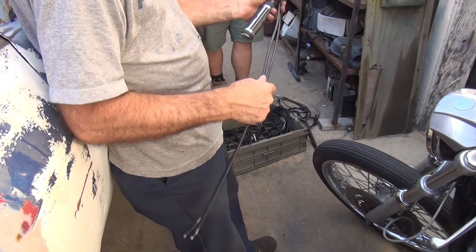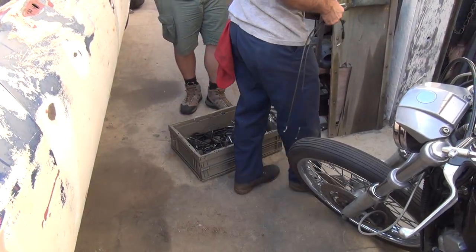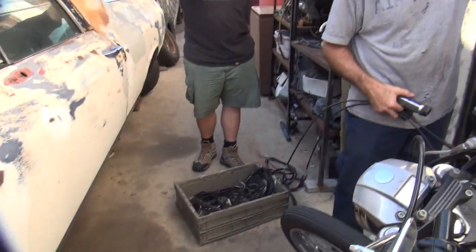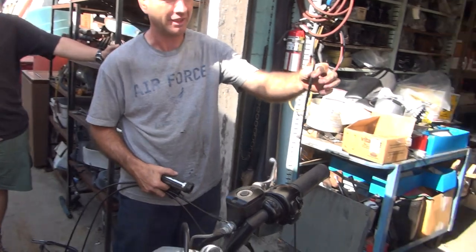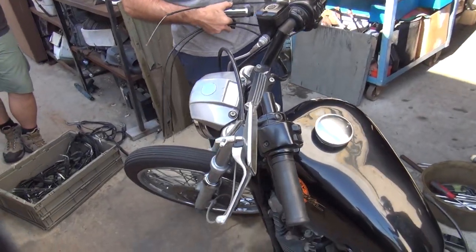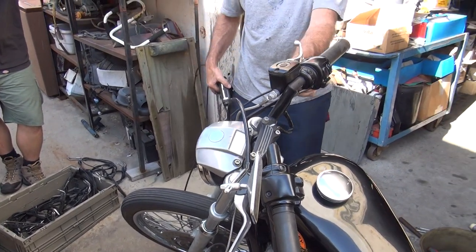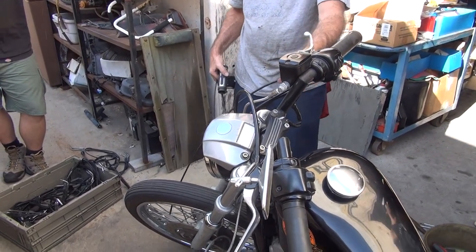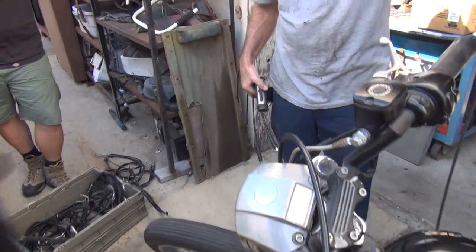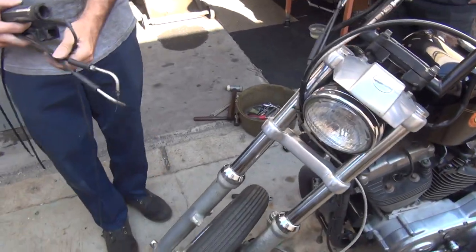There's a cable right here. Yeah, you use that one. It's the same color as yours. It's probably your old cable. It's barely broken in. There you go. Look at that. It matches. And it's the one that's missing. Look, it's the return one. Okay, let's see the free play. One's a 45, one's a 90, that's okay. One's a 40. Is the free play the same? Almost. Yeah. There you go, just gotta put some cable lube in it, it's good to go.